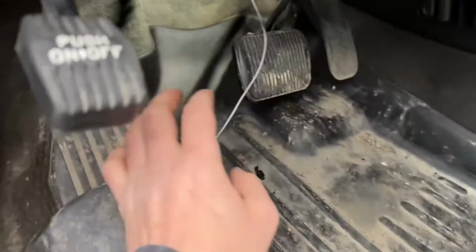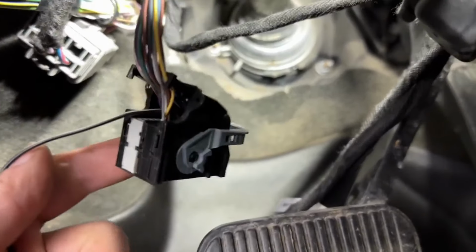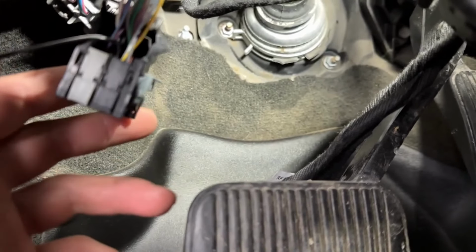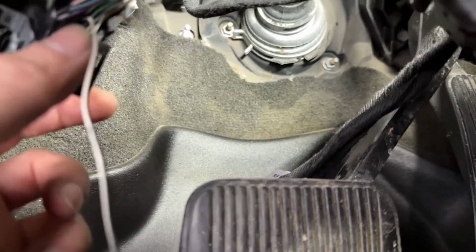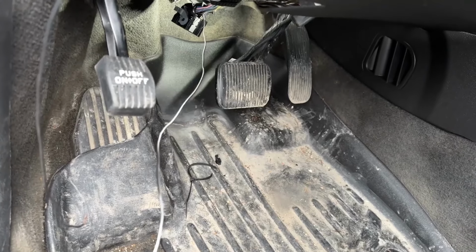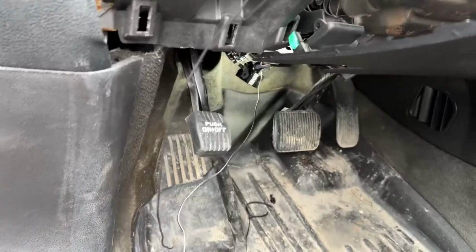All right, so I got really lucky, and because I'm a little bit of a hoarder, I had some old harnesses from other vehicle wiring, and I was able to find ones that were already pinned. Already had pins on them that were the same size, or at least close enough. And I was able to remove those from those harnesses and just pop them right in, so I didn't have to do any crimping. So into number 20 went this guy, which I think I robbed from a wiring harness from a rear view mirror from, I think it was a Subaru Forester, like a 2012 Forester. But I think these are pretty common size pins for most vehicles.